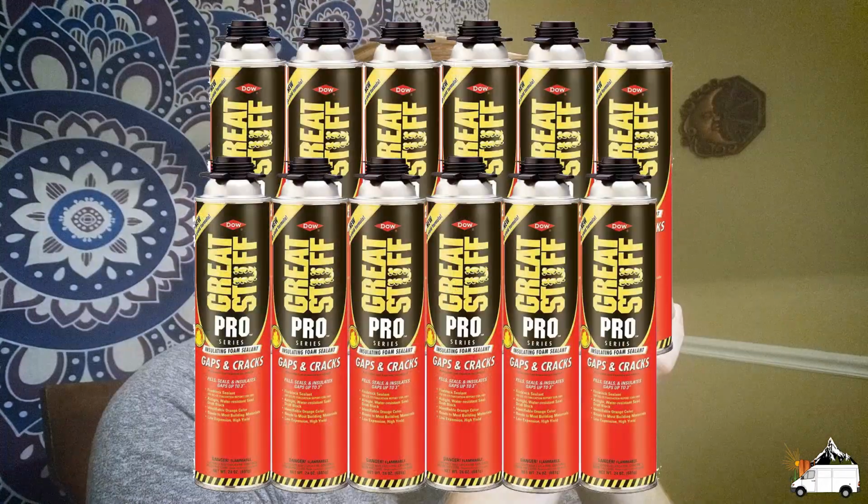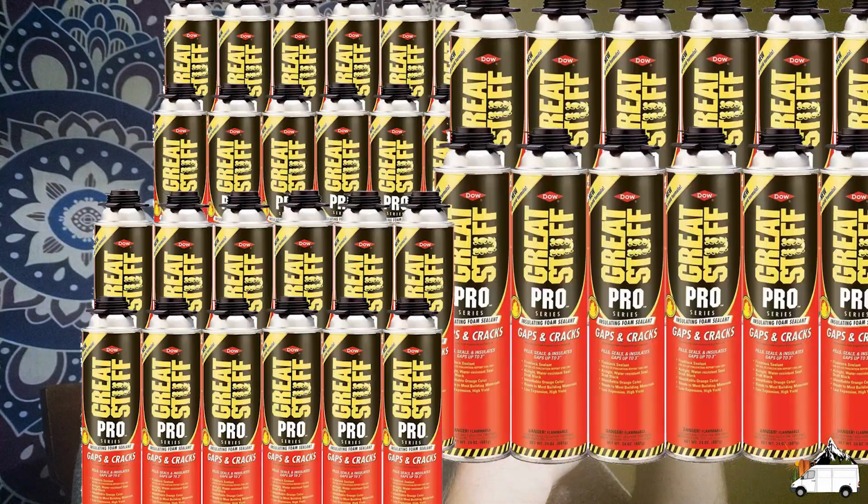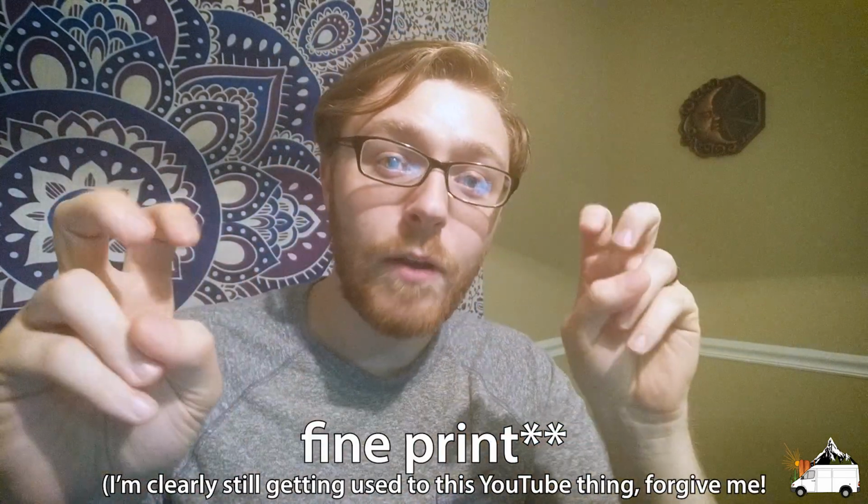Now, off of spray foam, I want to talk about canned spray foam. This is great stuff. I would not use canned spray foam to spray your entire van. For one, you're going to be buying a ton of cans, and for two, now this may have changed, but if you look at Great Stuff's product description, it used to say Great Stuff is a closed cell foam, but then in the fine line there, it says it forms a water resistant outer coating when cured.